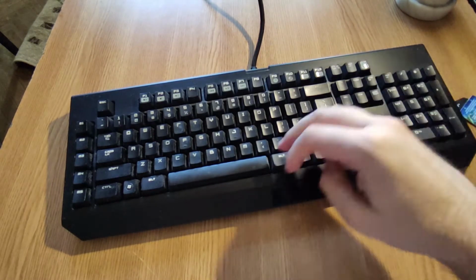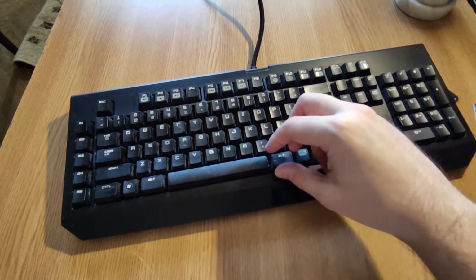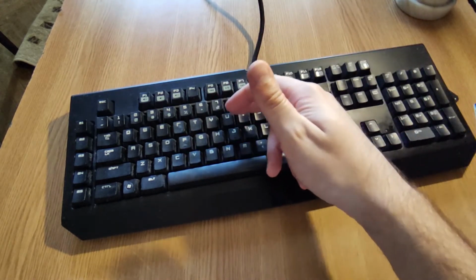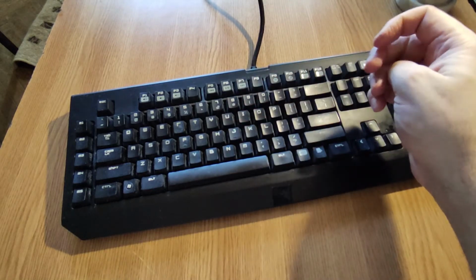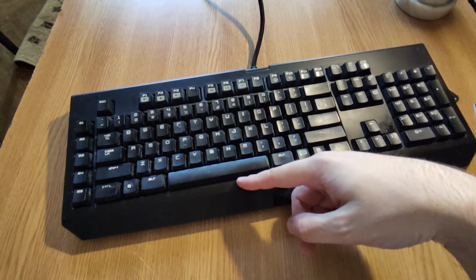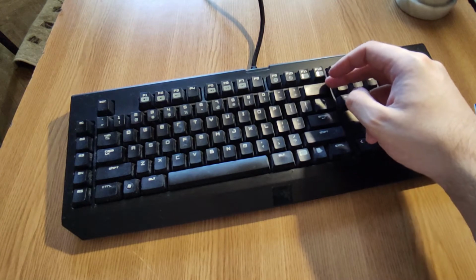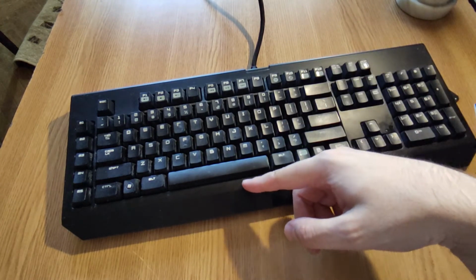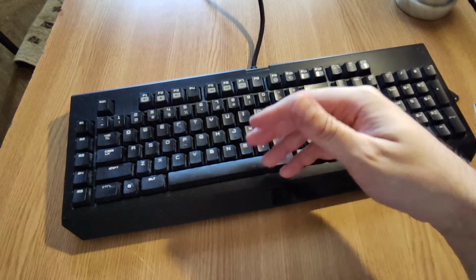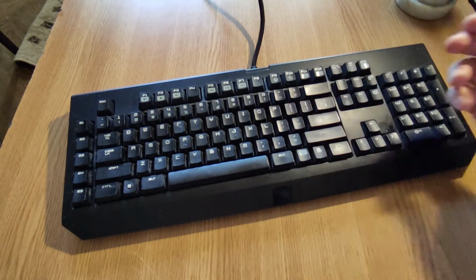And besides these items that you need to clean, it's also a good idea, after you remove all the keys, to just use a vacuum and pull everything that's behind the buttons. And one aspect to consider is that some keys should not be removed. The space, shift, I think backspace, I'm not sure. There are some keys that have some metallic elements, so it's not easy to just remove them. You'll need some tools, and also it will be difficult to just put them back, and it's just better to just leave them as they are.